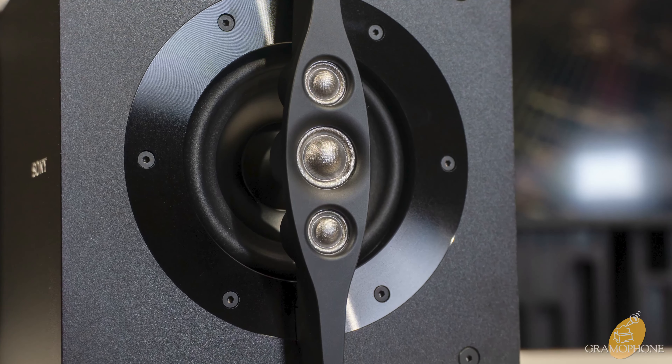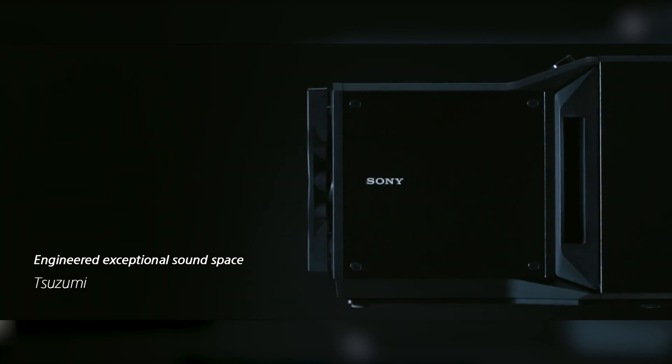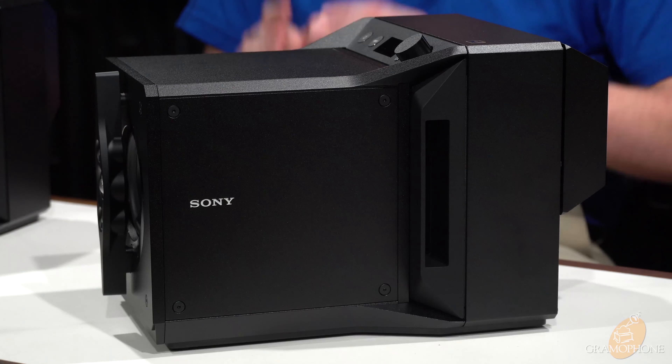These feature a built-in Field Programmable Gate Array (FPGA) for audio customization — keeping timing coherent and syncing the waves of each driver — so you can get the power of an orchestra or the fine detail of a solo. The coaxial design places the tweeters right on top of the woofer, and combined with the FPGA doing real-time tuning, gives you a perfect center image ideal for near-field use. Two woofers are placed at each end of the monitor and work to cancel out each other's vibration, eliminating parasitic frequencies.